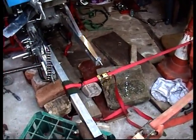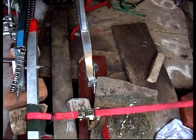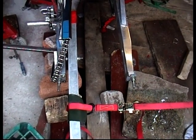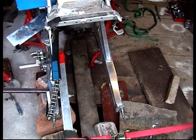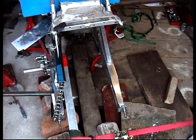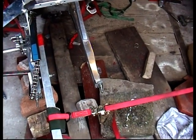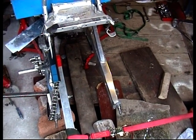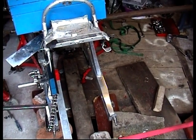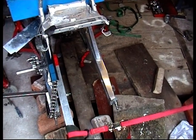I'll move the right-hand one over six millimetres to the right — that's under a quarter inch. I've now got the other one under stress; I left the first one overnight. I've only used an ordinary hand-held blow lamp with the butane cylinder, not a welding torch as it would be too hot. So hopefully it will age harden — depends on the metal. 6061T will age harden after it's been quenched; 7020 will harden itself at 30 days at room temperature. That's the information I have, but you never know what material these are, so it's a shot in the dark. But whatever it is, it's bloody tough stuff — it took some shifting so it's more than strong enough.